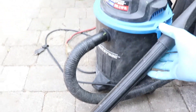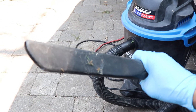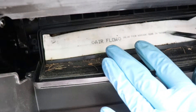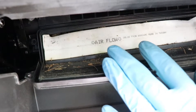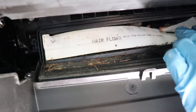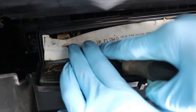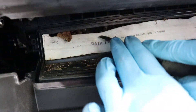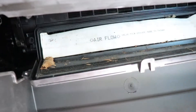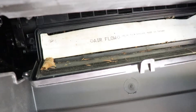So a simple trick we're going to use to clean it up is just a regular vacuum with a narrow tip like this, so we can get in there and clean the leaves before they fall into the blower motor. We're going to need to make an opening — it's fine if you destroy this one, we're going to change it anyway. So with a flat head, we're just going to squish the sides here to create an opening for our vacuum to fit in. And just from that, you can hear all the leaves that are stuck in there.